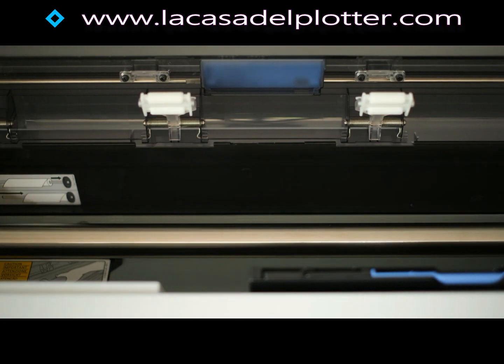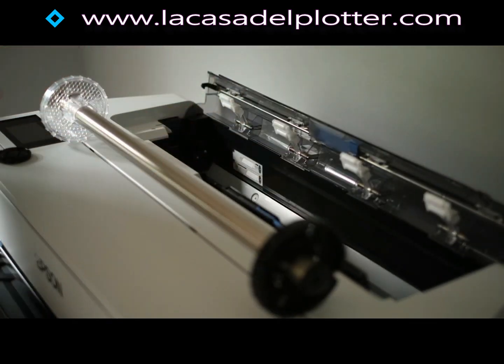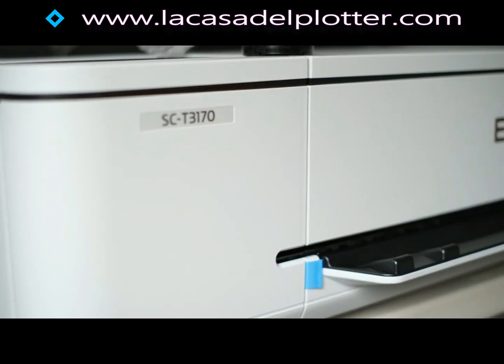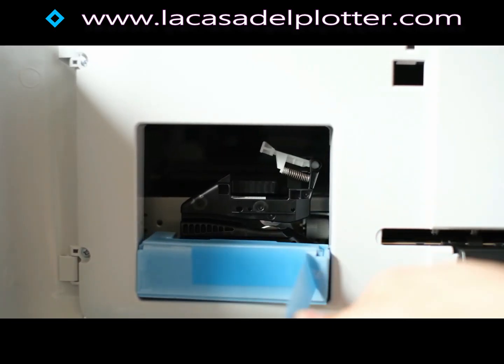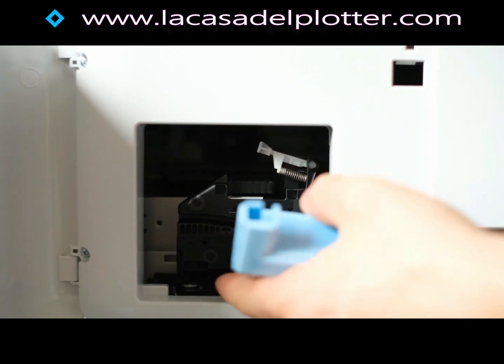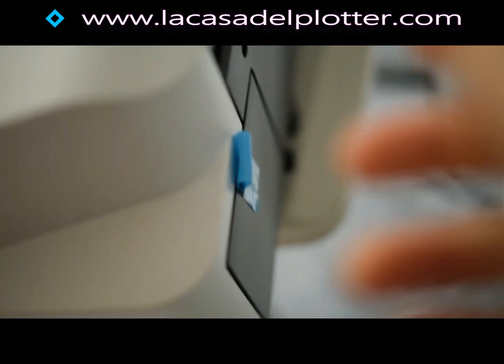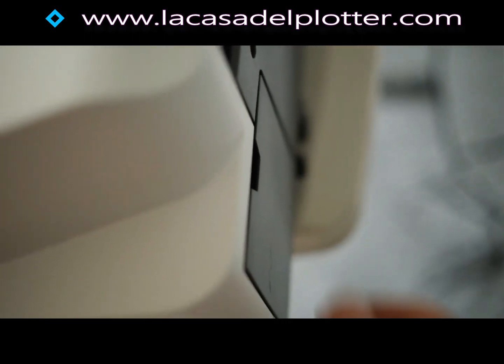Now you should be able to freely remove the printer spindle when you're ready to load some media in the printer. Then remove this piece of tape in the front of the printer, which will allow you to open the door in the front to the left to reveal the cutter blade. We then want to remove the blue tape holding on this blue protective piece. And the last step of the unboxing is removing this blue piece of tape here in the back, opening the door.